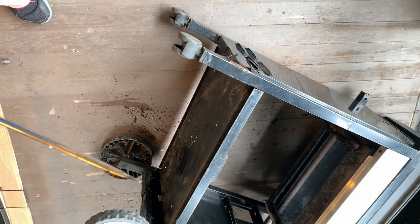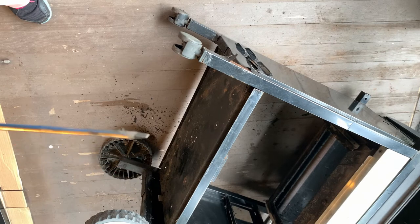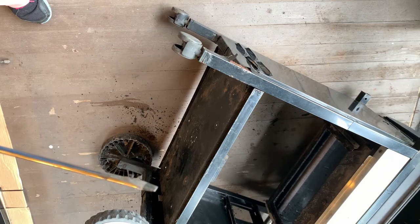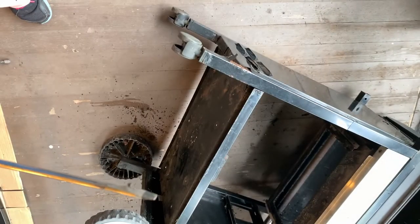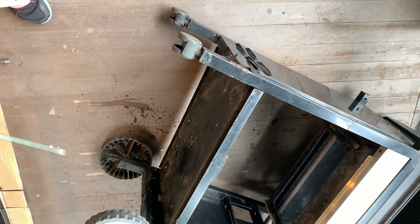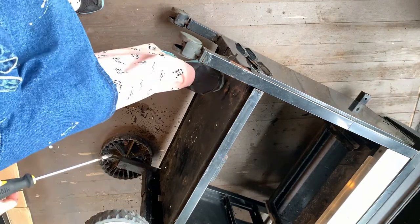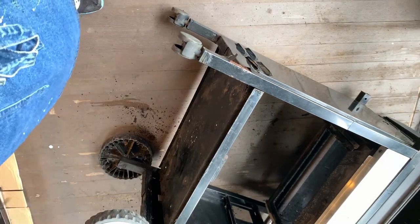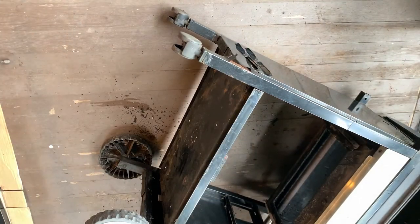And it was a matter of just sticking a screwdriver in there, prying it in, just to unclip it a little bit. And then I gave it a gentle kick from the bottom upwards, and that loosened it. I did the same thing on both sides. Since I am replacing this whole piece, I wasn't too concerned about giving it that gentle kick, but that kick pushed it inside towards the main area and released it.